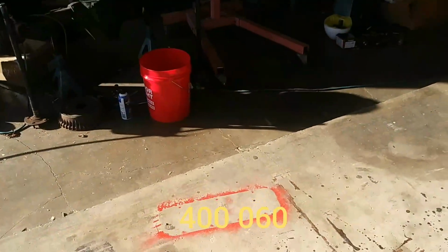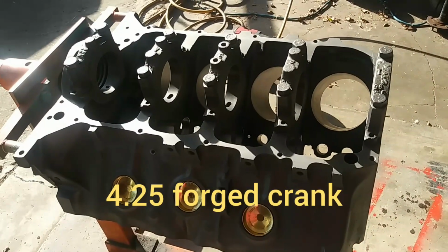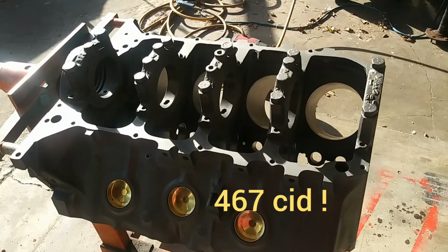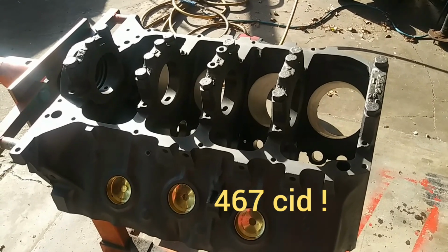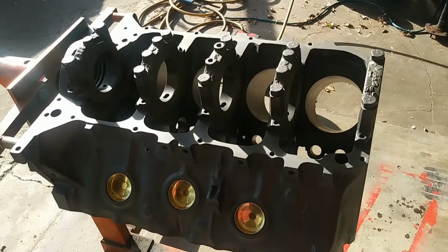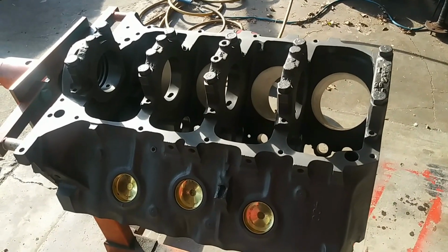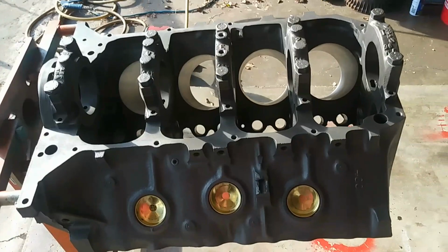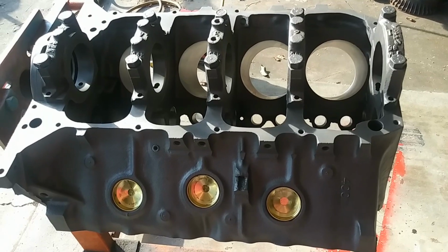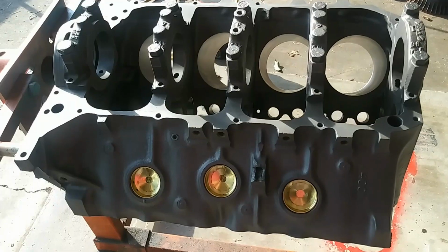Well, I'm in a holding pattern on the 455. I put the crank in yesterday because it turns out I asked my buddy to order 30 over rings on this re-ring forged motor that we were putting together, but my bad, those pistons were 40 over. They just had the carbon on them and I had forgotten what size they were. The thing had sat around for a year. I was checking the ring gap and it was way off, and I was confused and put the old ring back in and it was perfect. And yeah, maybe because it's a 30 over ring and a 40 over bore.